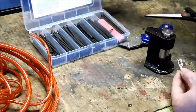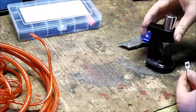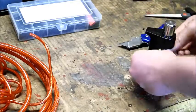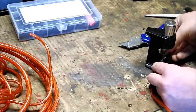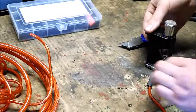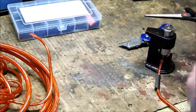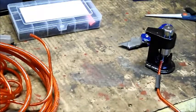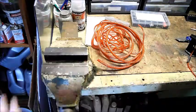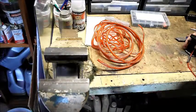I don't use this with a hammer — I think that's a dangerous and brute force technique. The better way I've found is using a vise. You lock the hammer crimp in place, then place the lug with the wire installed inside. There's a little groove and depression in this hammer crimp designed to carry these lugs. Instead of whacking it with a hammer, which you could do if you don't have a large vise, I make use of my big desk vise. This gives a better, much more controlled end result — you can really control the crimping process slowly.